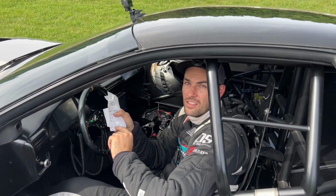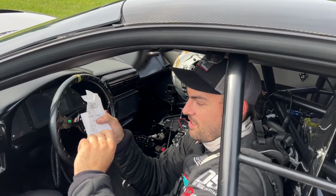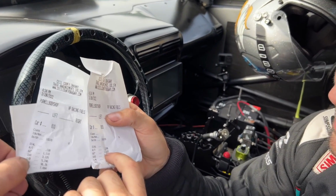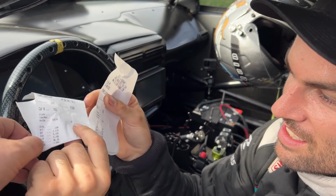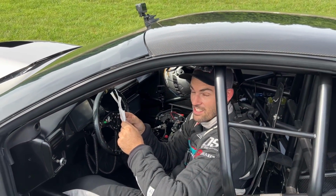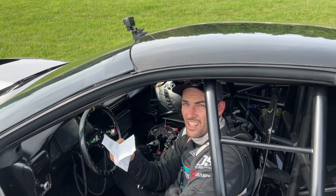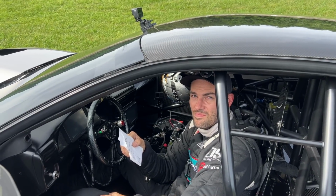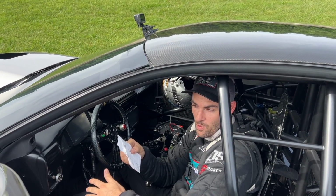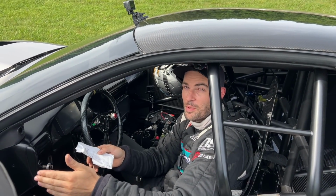It was before the 330. You lifted before 330. It still went 310. So 110 to the 60 foot. 111 flat. Oh, I thought it was 110. My bad, 111 flat. I was reading the wrong number, but still, that's a little faster than what we just did. So that was setting 2. Did you have the dump on? Yes. Okay, so setting 2, dump on, 4 clicks more into the front end, and that was, I would say, pretty perfect, other than getting a little wobbly. The car was drivable like that, it's just a test pass.